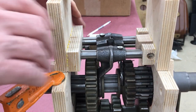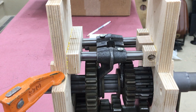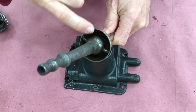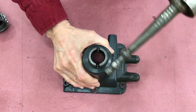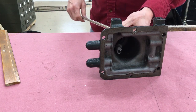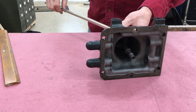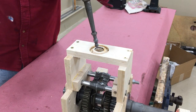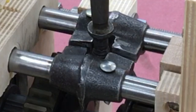The wooden tower goes onto the wooden casting — this is actually working out okay. This is the shift lever. It has a couple of pins that hold it in the top of the casting to prevent it from rotating. The casting has cutouts for the pins and a machined area to accept the bottom of the shifter. The fulcrum for the shift lever is at the top of the tower casting, so when you move the shift lever down and to the left for first gear, the ball that controls the shifter fork moves up and to the right — the opposite direction. The shift lever is the last piece, and you can see the ball end is now resting on the cutout in the top of the forks.